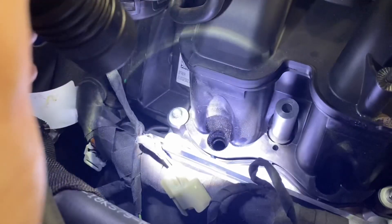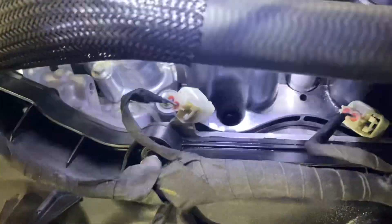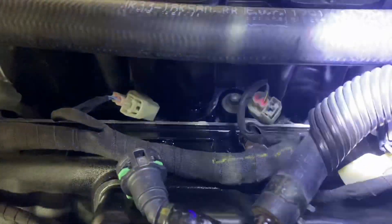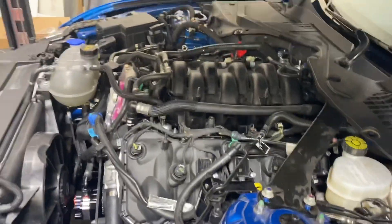Sometimes in older cars it's not uncommon to see some crud around the O-rings - things tend to fall in there. Take a flashlight, shine it in, and make sure that seating surface where the bottom O-ring goes into the manifold is nice and clean before we reinstall. Even with 4,000 miles on it, you get a lot of crud. Unfortunately, there's not really a great way to clean that without knocking stuff down into the motor. Take a rag and just try and wipe some of that out - we don't want to knock a bunch of stuff down into the intake.